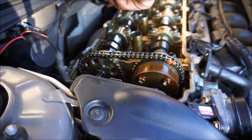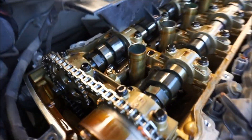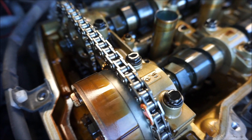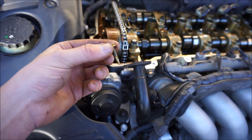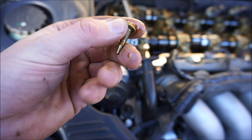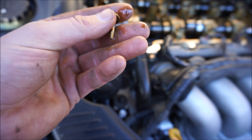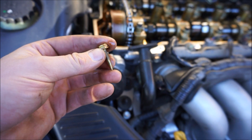Inside it looks pretty attractive — everything looks pretty fine. I'm gonna look over the lobe and see if there's any wear. Here are the lift bolts A and B — let's do lefty loosey on those two, and that's what we're replacing today. Intake side right there — you guys can see that little mark. You can feel a deep groove; it's been used. This car has 90,000 miles, so it's a good thing to replace them.